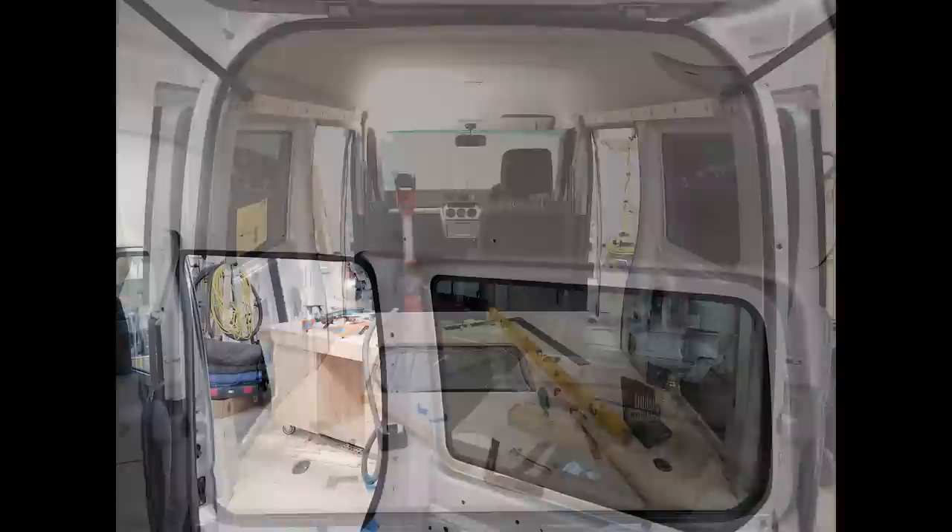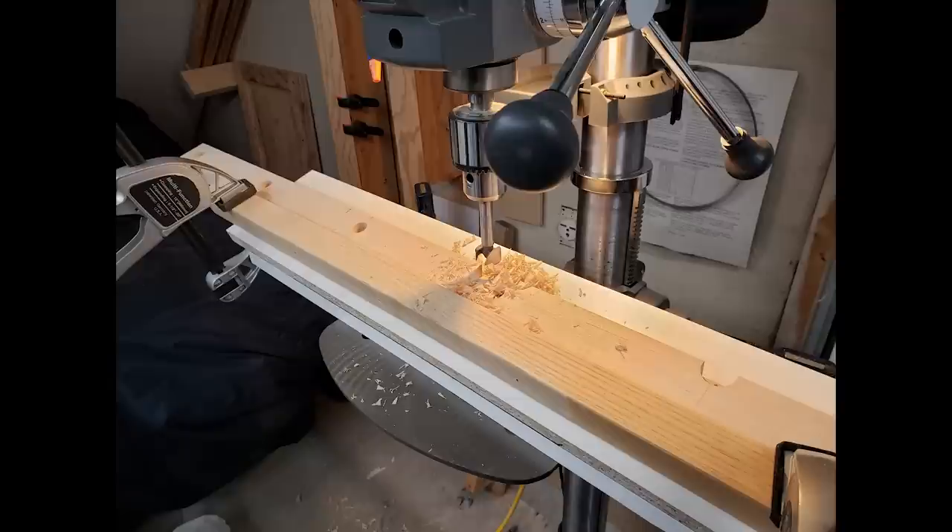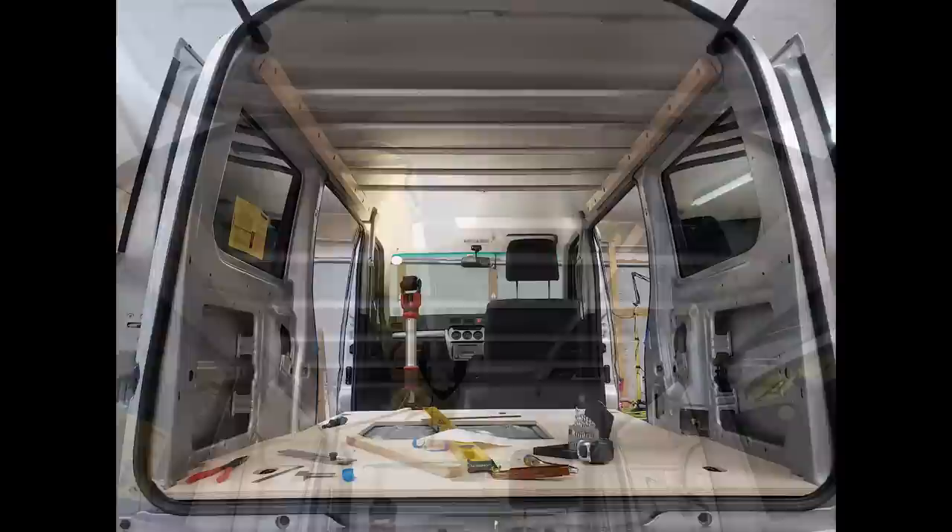With the floor done, I started working on the side rails for the overhead rack. I made use of the factory-installed threaded inserts along the top of the walls to attach the rails to. All of the holes had to be drilled at a precise angle, so I made a jig for the drill press. The aluminum bars fit into half holes in the rails and create a rack for carrying tools and accessories that are long and flat. With the rack done, it was time to start framing the divider using aluminum angle. The top of the divider was tied into the side rails of the overhead rack, and the bottom of it was bolted into the old mounting holes for the back seat.